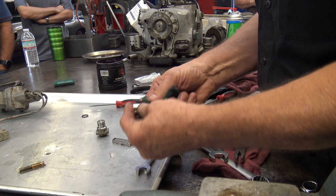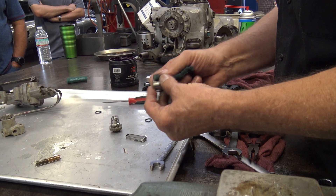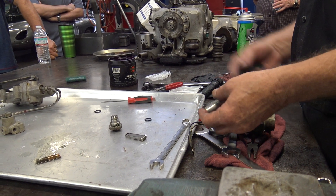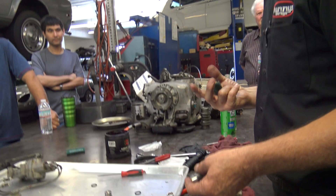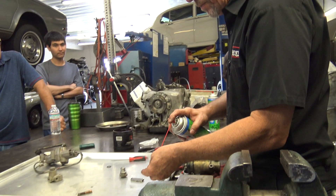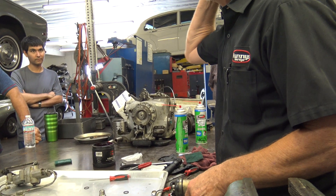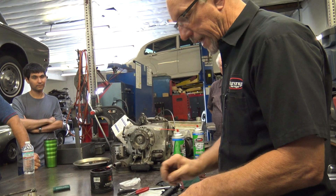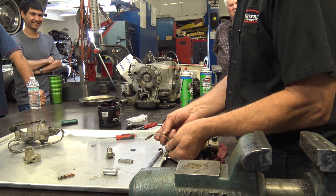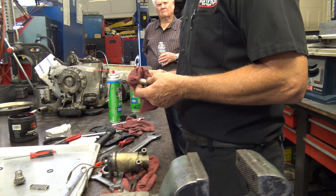So I'm going to polish this up. This was definitely stuck — I had to bang it to get it out. The one trick is, when you're working on it on the car and you pull this plug out, it would just fall out with all the piston, and then it's a real challenge to deal with. So there is a trick: if you're quick, you just turn the ignition on in neutral, open the door, and it activates this and pulls it up so it doesn't fall out. Or you can hotwire it — one goes to ground, one is just the battery. Can you deplete the accumulator down before you start working on this? Yes, you've got to depressurize the system.